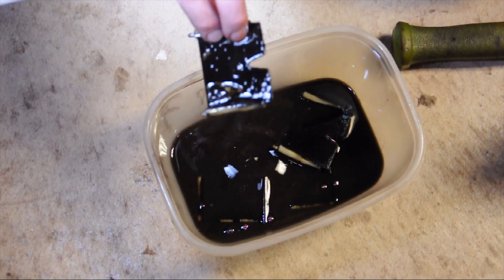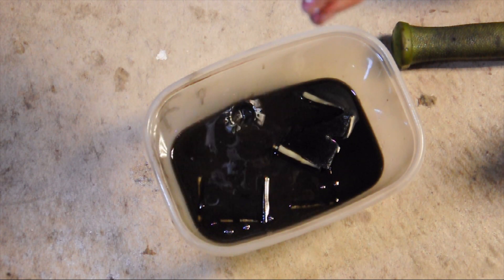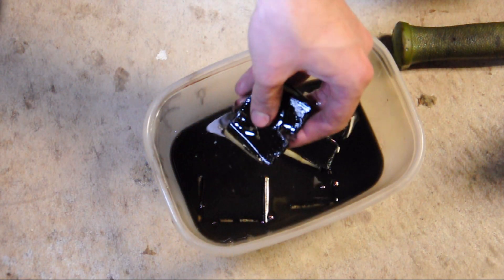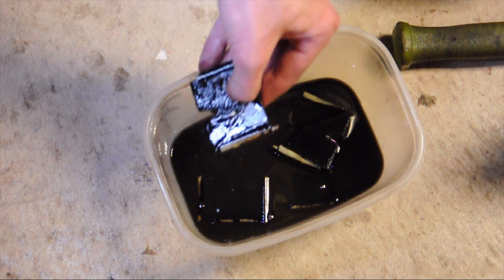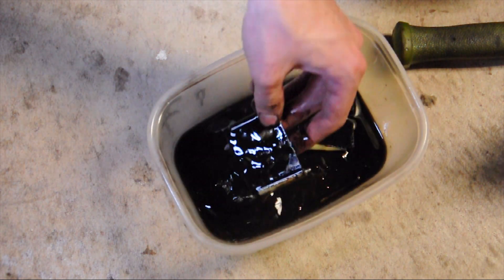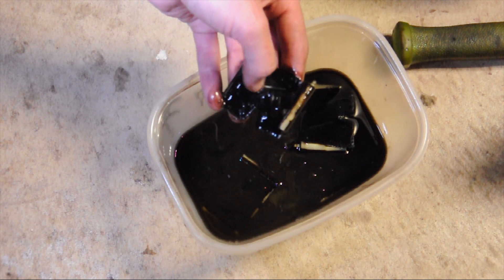These are the flaps — they're sitting inside the cylinder head, and they're all dirty. So I pulled them out and we're going to soak them in brake cleaner and that valve cleaner. It's been soaking for maybe 10 minutes and you can already kind of scrape it off with your fingernail, so something's working.